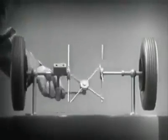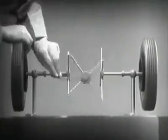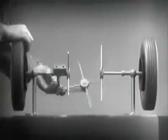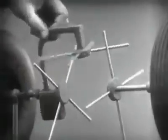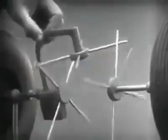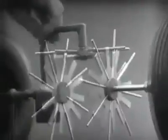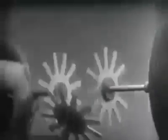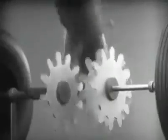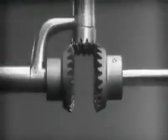Now, we have the working principles of a differential. To adapt the model for use in an automobile, we will have to make a few changes. In order to reduce the jerky action caused by wide spaces between the spokes, we will put in more spokes. Further filling in the spaces between the spokes gives steadier, more continuous action. And, changing the shape gives firm, constant contact. Now, we can make the gears thicker and stronger, and we have differential gears.